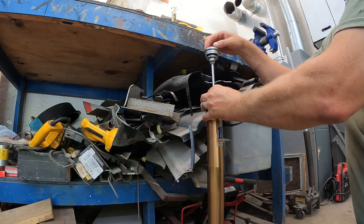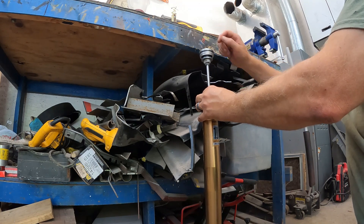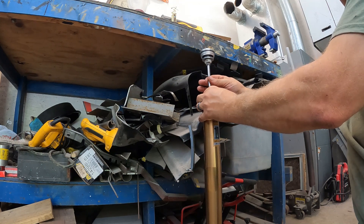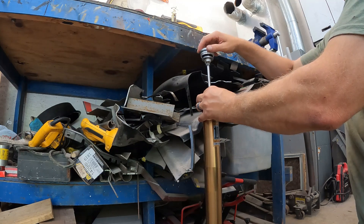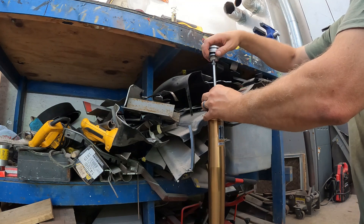You need to put a 14-millimeter on this nut and a 17 on your fork cap — break those two loose. Chris had a little bit of an issue getting this cap loose; he had to clamp it with some pliers and leather. But mine, once I broke them loose, I could take it off with my fingers just like this.